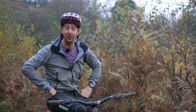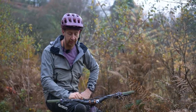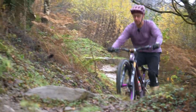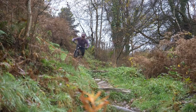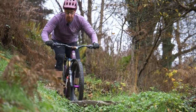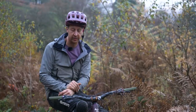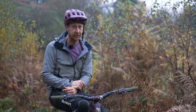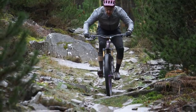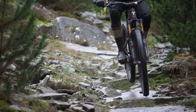Today didn't go like I thought it was going to. I thought at the beginning of the day, chucking tubes in, I was going to be literally doing that same thing all day long. I've had two pinch punctures on the rear. I'm amazed I didn't get one on the front, because riding a lot of the rockier, red-rated trails here at Bike Park Wales, I think reflect the bike quite well. So, Nukeproof Reactor, 130, 125, trail spec tyres on here, not running crazy tyres. I'm surprised, because you could hear the rims all day long, really rimming out, but I only had two pinch punctures. That's not as bad as I expected, and I was running fairly low pressures deliberately just to see what would happen.